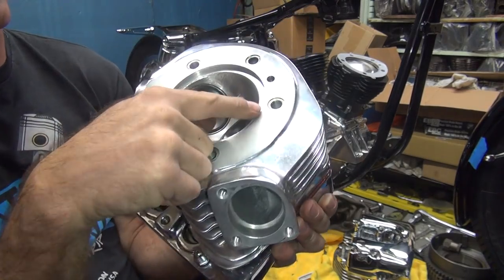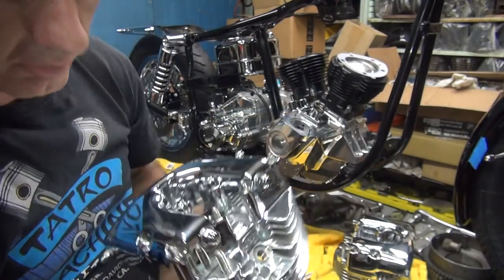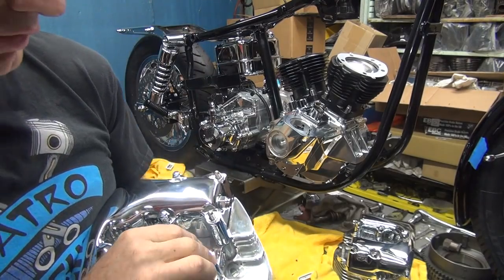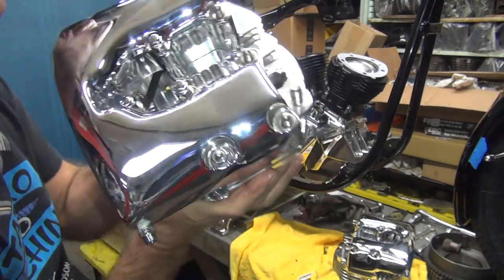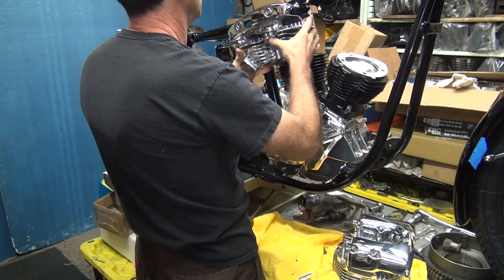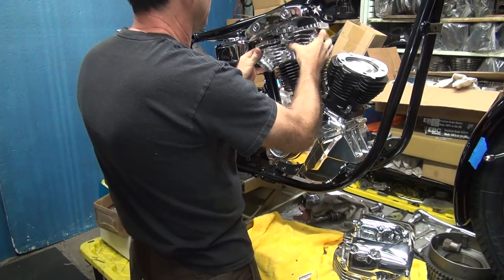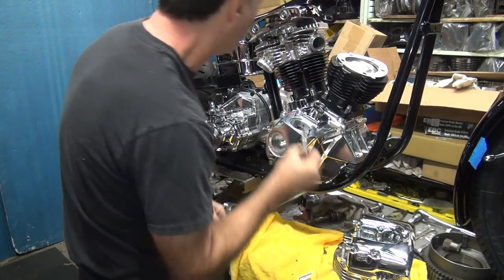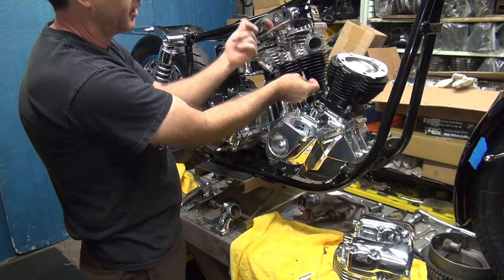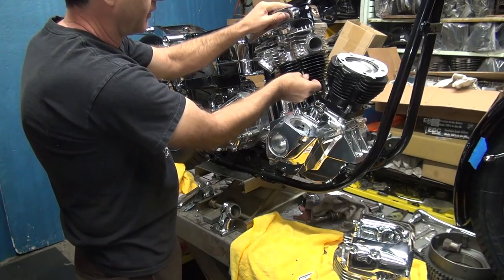If you do, it gets two big gouges right here and right here, and causes lots of problems with the head sealing. I just lost one washer because I showed you something. So, which one's missing? That one's missing. Okay, so now I'm going to put this in here. This one only fits in one way. There you go. Push the bolt up to hold it in the gasket so it won't rotate, and you rotate the head until it drops in. And it goes in there like that.